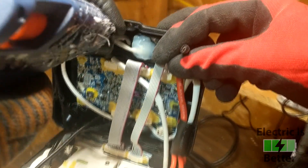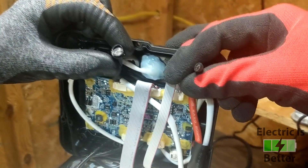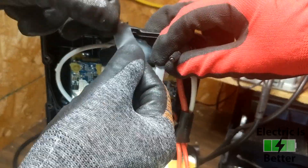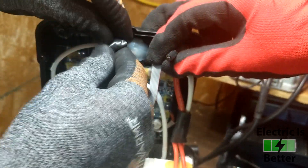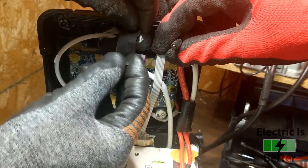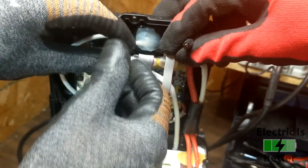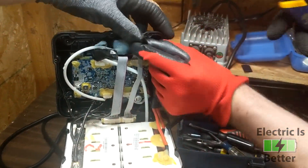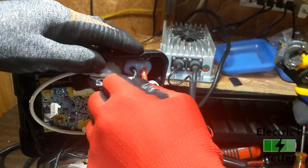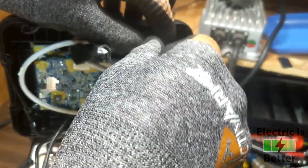After that, take some hot glue and go over the end of the cable that we're not going to be using, then wrap it up in electrical tape. It's still going to be watertight in the case, but I don't want the tape coming undone and touching the positive terminal and ruining the battery. Next up we're going to strip the rubber off of our other cable — this is where we're going to hook our bypass wires onto. You can use scissors or pliers; we had actual wire strippers so that's what we used. The wire is not solid so you're going to have to twist it together to make sure it's not fraying.